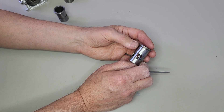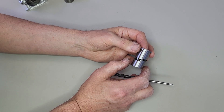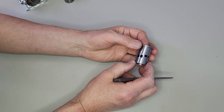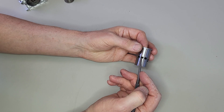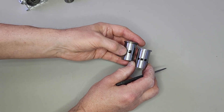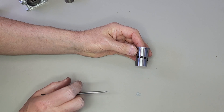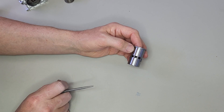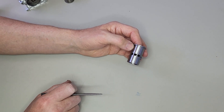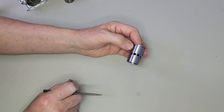This is the liner that we manufactured at PhilTech for the Leslie V12. We've made various changes: firstly we've gone with a more conventional style of inlet port, and you will notice that the exhaust ports are a flatter design compared to the Fox ones. That's because we open our valve timing later, as we're only revving at around 7,000 revs — the Fox 40 would have been designed to rev at 12,000 revs. So we can attain higher torque and power at 7,000 even if we sacrifice high-end RPM, because we're never revving at 12,000 RPM.